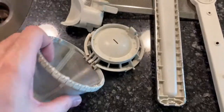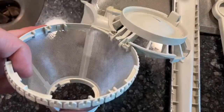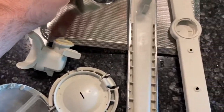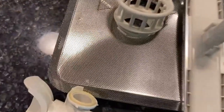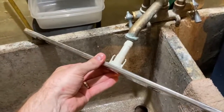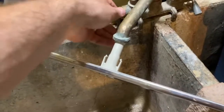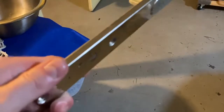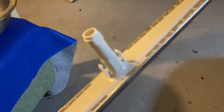We've got a little residue remaining after cleaning all surfaces. You want to take out the filters and clean them — that really hot water just melts the wax away. Check out this cleaning job; this is great. Take out the arms and trays as well, run them through really hot water, and push all that wax buildup through. That got everything taken care of.